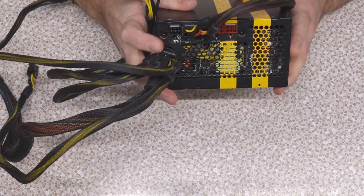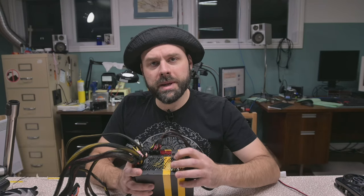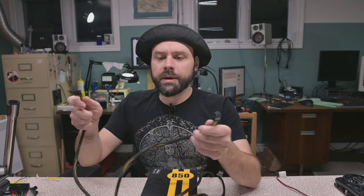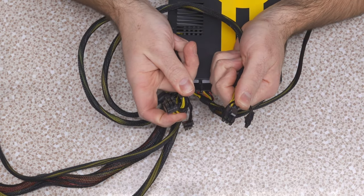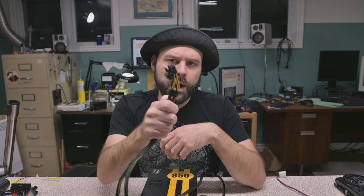Your HDD and SATA, as we know, is on V2. And V3 and V4 are PCI Express, but we also have two fixed PCI Express connectors that are also V3 and V4. So you'd have to know to balance your load that way. Chances are if you had two cards and just use these ones, you'd be okay. Or if you put one card with both of these, you're gonna be okay. So like as mentioned, it was a little bit tricky, you had to be mindful of it, but it was hard to really screw up.